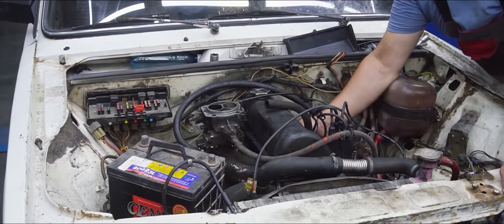Cylinder number three is the one with screws. What's curious is that now we don't see any of them in there — so they've evacuated. Here we see pretty much the same picture as in cylinder two, and indeed cylinder number one for that matter. The head has sustained severe damage. First look at the wide casting and then at that narrow bit. The piston, once wiped down for a closer look — same story. The piston is located right across from the head, so there are going to be fewer craters next to the narrow bit and more next to the wide casting.